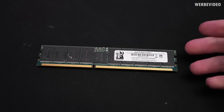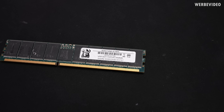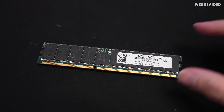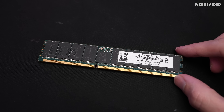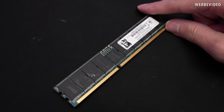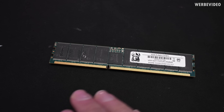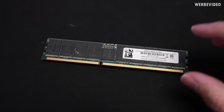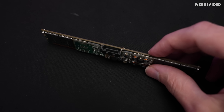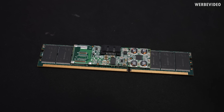What we have here looks like a memory stick, a normal DRAM stick, but that's not the case. It's still called DIMM — dual inline memory module — which is true because it's still a memory module form factor, but it doesn't contain RAM. It contains flash storage. We can see all these flash modules, and in the center we have a pretty typical Sandforce controller from back in the day, common on OCZ drives. That's why it's called SATADIMM: it's a DIMM with a SATA connector forming the entire SSD.